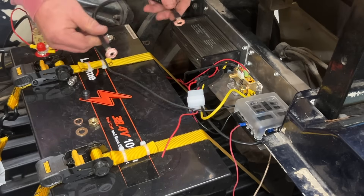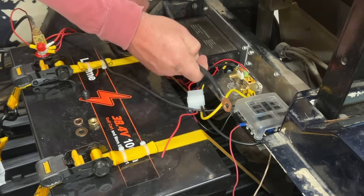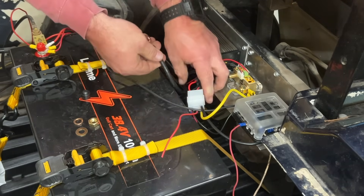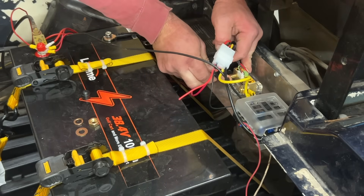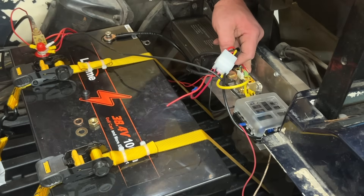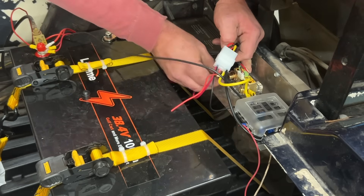I got a six-gauge cable, went ahead and shined off the ends to expose more copper. It fits perfectly fine on top of the battery terminal on this side. On the larger hole on the shunt side I had to open the hole up just a little bit — this bolt is a little bit bigger here. Put a washer, lock washer, and nut on there and that is now installed. That's the battery side of the shunt done.